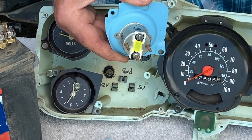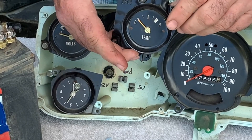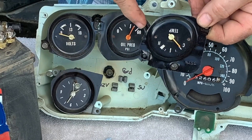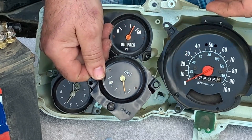This one down here is not used. However, quick tip — if you have a gauge that's buried in one direction, you can take this gauge, flip it upside down, and plug it back in. If the gauge goes directly the opposite way and buries the needle again, you've got a bad gauge.